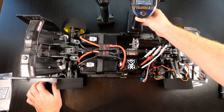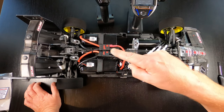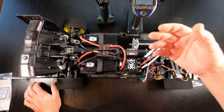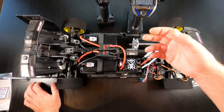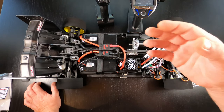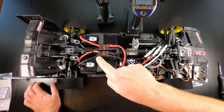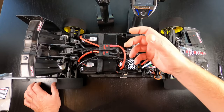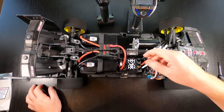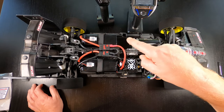When you pull your Castle Link dialog, you might see that the throttle line is not completely 100% linear — it has little steps. The throttle input by Perfect Pass doesn't have steps. The problem is that the refresh rate with Castle Creations is either 5 or 10 times a second, and the refresh rate of Perfect Pass is a lot faster than that. So whenever the Castle Creations logger samples the line, this is when you'll see a little dip. It's still going to be a perfect beautiful line from 0 to 100. It really depends on the timing of when you're pressing the throttle, based on the refresh rate of Perfect Pass and the refresh rate of Castle — if they're synced or not at the same moment. But you might see little dips — you can ignore that. Those are not dips; this is just the line going straight, but Castle is sampling it 5 times a second.